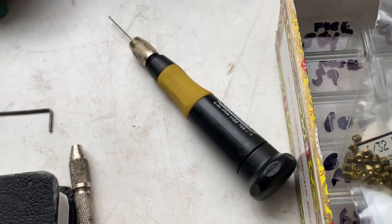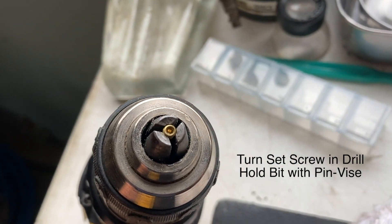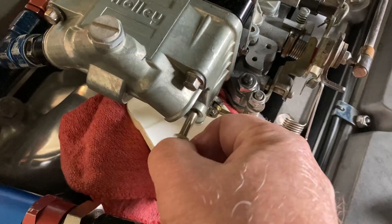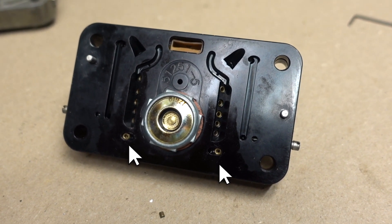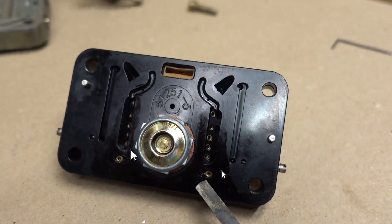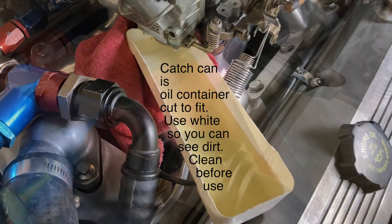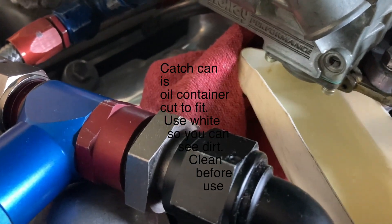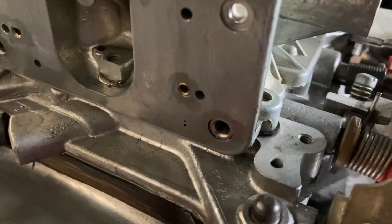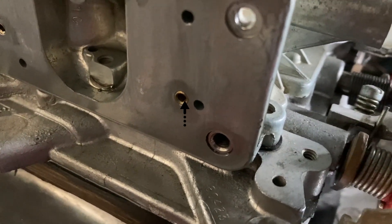So to get the car to run up here at 5,000 feet where there's less air, the idle circuit took three basic adjustments. The idle feed restriction that supplies the fuel to the idle mixture adjusting screw needed to be made a little bit smaller. When the idle was right it was still too rich about 1,800–2,000 RPMs in the transition slot, so this carburetor has a little jet in the transition slot circuit and I had to reduce the size of that jet.